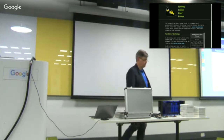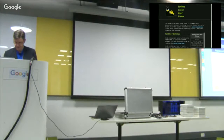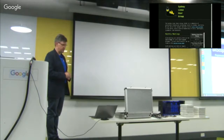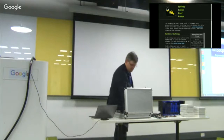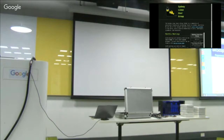Q: Are you able to mount an SD card there? A: Yes. Obviously anything that connects via USB you can just plug straight in and run. The Raspberry Pi 3 will get you to about 40 megabytes per second, but not more than that. If you've got an SSD that goes way beyond that, you're not going to use the full capability of it. We're also looking at hats available on the market which are able to plug in mSATA modules. Here's a blade with a Raspberry Pi and mounted on top is an mSATA module. One of the beauties of Raspberry Pi is that there are all sorts of accessories available.